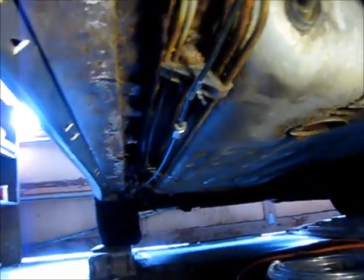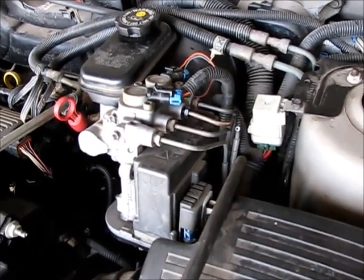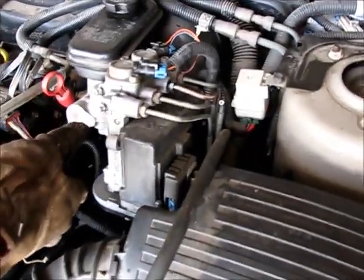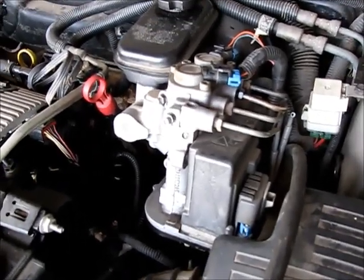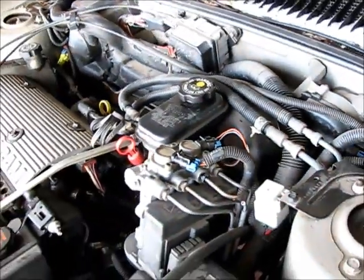So there's our finished line on the back end, looking back. We've got it attached in four or five different places heading back to the front. We're all done with this Grand Am — replaced the left rear brake line all the way to the back in three sections. We've just bled the brakes, doing a four-wheel brake bleed, which on this vehicle also includes the ABS. I do have a write-up on that, step-by-step, on my website. Got it all topped off and ready to roll. Thanks for watching this video.